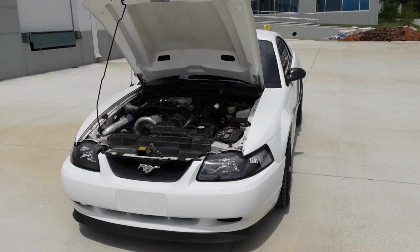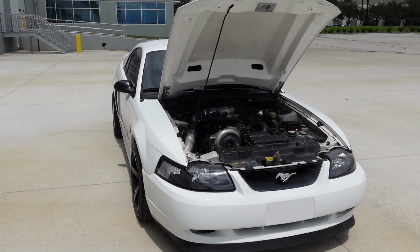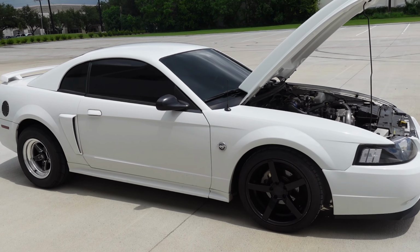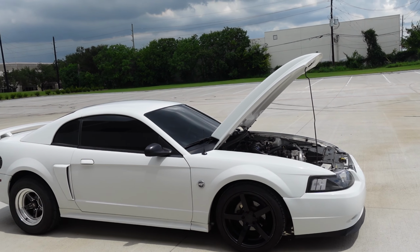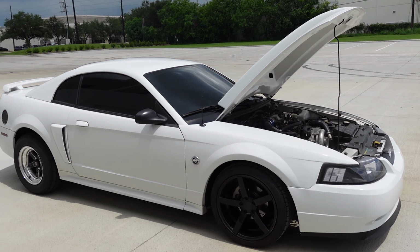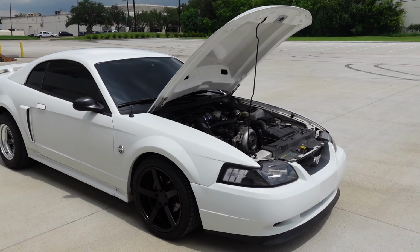I'm kind of downplaying this, but in all reality, it's still not bad at all. I mean, 600 horsepower on a two valve, I could put in work with this. People have made really good power with stock head, stock cams, built bottom end. Mind you, the compression is gonna be turned up as well, and we're gonna be on E85, so it's still gonna be a solid setup. Might not make 800, 900 horsepower, but 600 horsepower on this car, hey, I'm excited to go ahead and have fun with it.